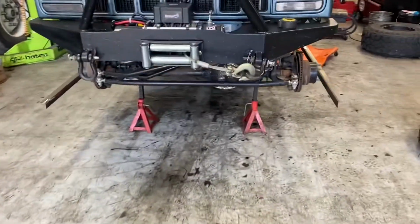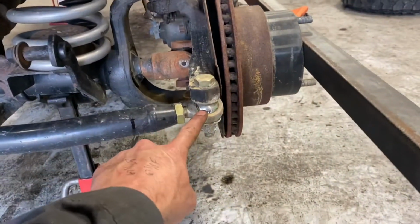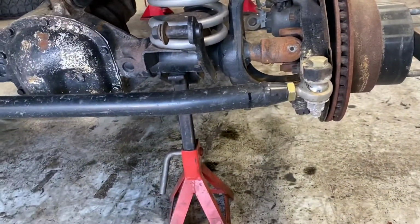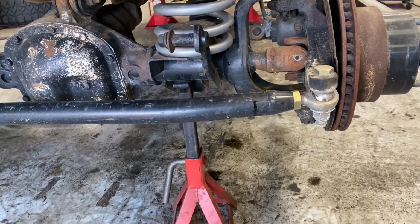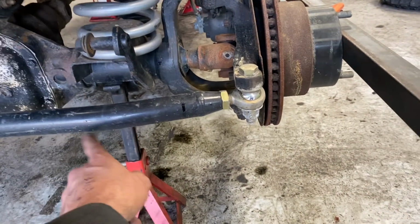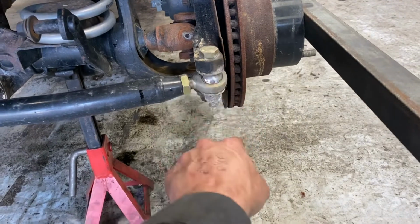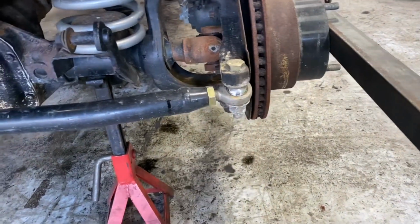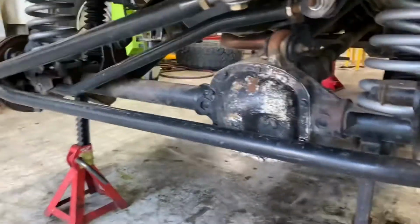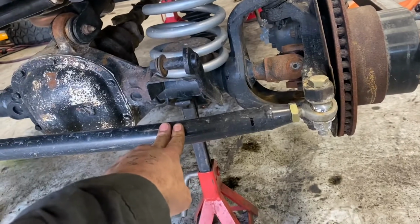And yeah, get this bar loose, because I know these things are a pain to set up if you haven't ever done them. And there's a trick to it. You don't want your bar drop down or your bar up. You don't want one Heim down then the other Heim up. That's just gonna wear your Heim joints out way quicker. And if you're curious on what steering this is, it did have stock on it when I got it. This is a Steinjager.